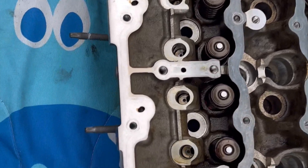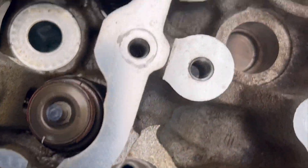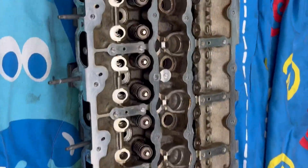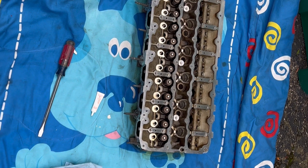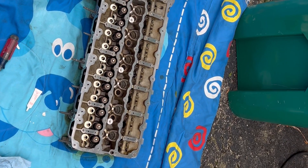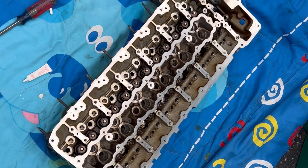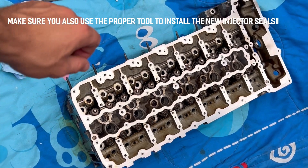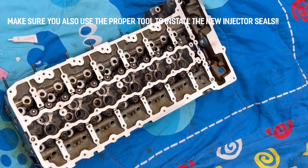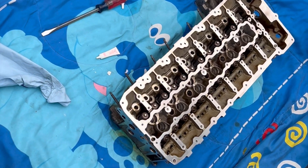To conclude the video: the injector bore kit — successful. All inserts in every cylinder, nice and flush. Overall it was a pretty easy job. All the steps are the same if done in the car, except you'd be more careful about capturing shavings — greasing the bit and cleaning it more frequently. Follow this guide and you should have a non-misfiring M54. Good luck everybody — they look nice and flush, so I'm sure it's going to hold compression in perfectly.